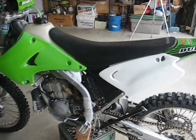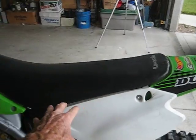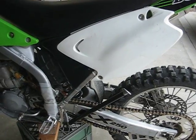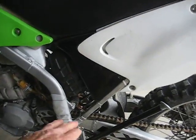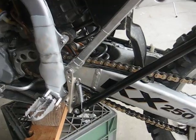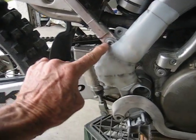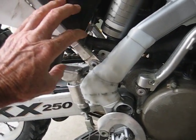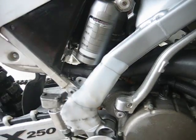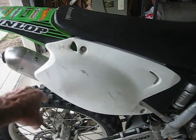So what I'm going to have to do, first of all, I'm going to have to take the seat off. To do that, I've got a couple of bolts, one on each side. In my case, the gas tank has to come off because I've got to remove the subframe to be able to get to the rear shock. Now there's four bolts on the subframe — one here, one under the seat, a long one, actually three bolts, and then there's one way over this side. I don't have to remove the subframe completely, I just have to loosen the bolts, and also undo the air boot at the back of the carburetor, and just slide the rear subframe back. But before I do that, I have to take this side cover off and remove the silencer, because that's attached to the subframe.